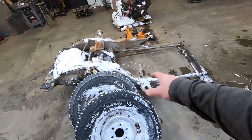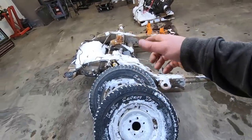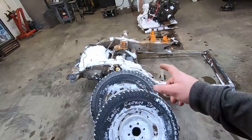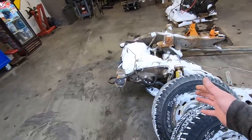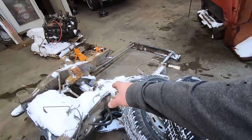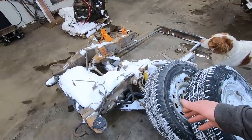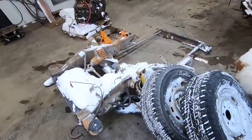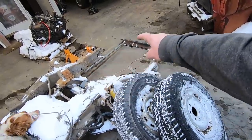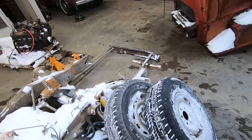I didn't want to waste a perfectly good rear end on this thing. So we got this front end out of a, I think it's a 90. Yeah, any 88 to 94 GM four-wheel drive. So we'll have four-wheel steering. And if we do get this thing to run, we can hook the drive shaft up to this and we can drive it. Worst case scenario, we can just weld the steering straight. We'll probably have to weld the suspension solid because this thing's a torsion bar suspension, and our torsion bars are just kind of hanging out there, and they're probably going to get cut off, too.